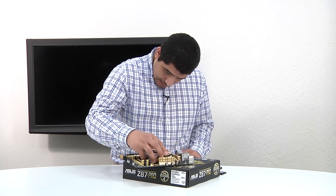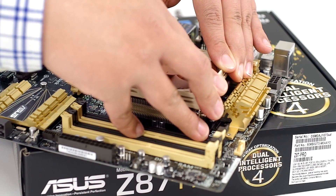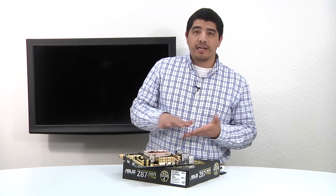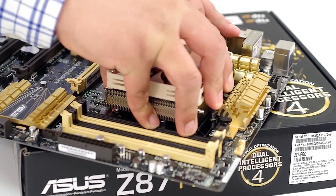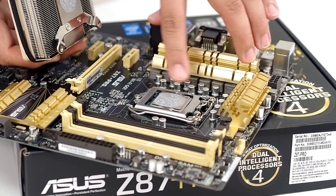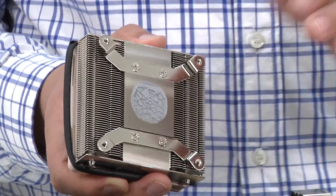You want to apply a good amount of downward force. We'll place the heat sink on top, press it down to allow the compound to disperse, and then check how much has spread across. We'll keep it torqued down for about 10 seconds or so — of course the longer the better for more even dispersion. This is for those who really want to verify the amount applied. At this point it's spread out a bit, so when pulling up just be careful not to pull away too aggressively so you don't smear the compound. You can see we've got a pretty clean, circular contact in an almost square-based fashion. From the second camera angle, we've covered a pretty good area — the upper portion of the CPU is well covered. If you notice any gaps, you could move the heat sink or spread it out a little bit, but overall that's actually pretty solid.